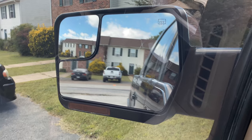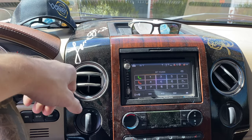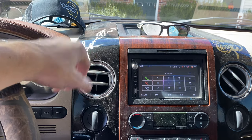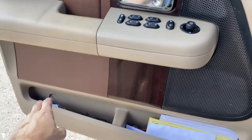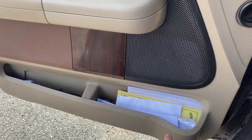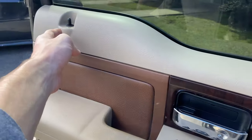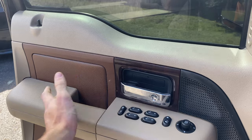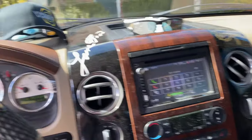I cut the music off and now we're going to step outside the truck so you can hear what it sounds like from outside. Keep in mind I do have sound deadener in this truck — it's not the full 80 mil, I believe it's 50 mil. I think it's called KilMat — I'll post the link below. Super easy to do yourself, you just need the sound deadener and a little roller. On the doors, I have it covered from the corner all the way up and down on the inner door. I couldn't get to the lower parts due to how the door was made. I also have it on the metal latch for the door unlock on the outer door, just to keep that from rattling.